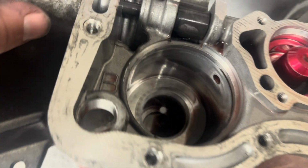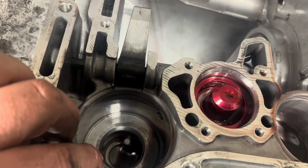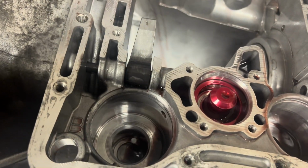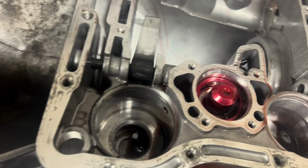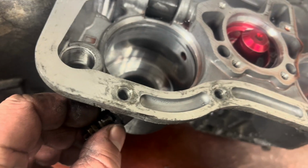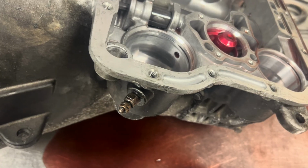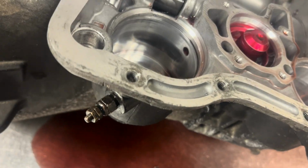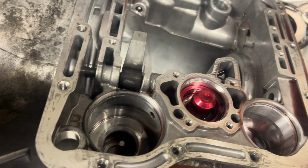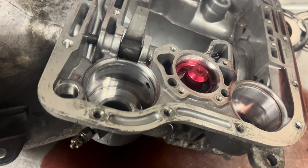So what that was doing is that is totally screwing up your second gear timing. If that spring's coil bound, you're not going to be able to put as much pressure on the pin to keep the band applied, and then it's going to change how quickly it releases. So it's a simple, just honest mistake. Most people aren't in-depth transmission people when they put these trans temp gauges in their truck, and they just find an open port and stick it in there. But in this case, this was actually probably a lot of the reason why that second gear band looked as ugly as it did, along with the things that I talked about earlier in the video.